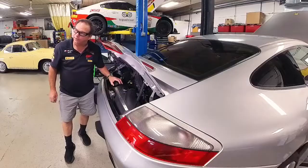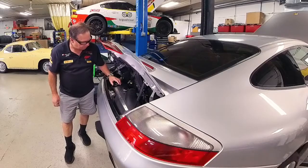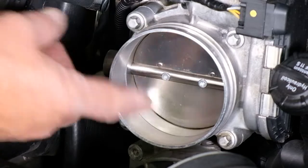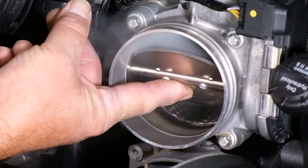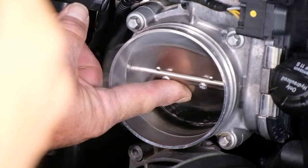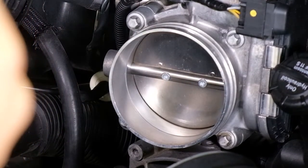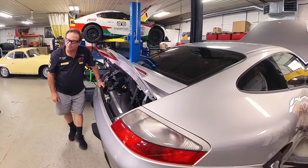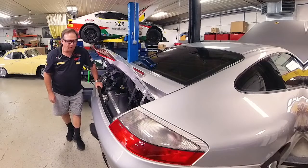While you're in here smoke testing the system and checking the oil fill tube, pay close attention to your throttle body. You notice the little dirt ring that's in the throttle body? We just smoke tested the intake and you can see that ring. The modern cars — meaning the 991 911 that started in 2012 — actually test for this, and that parameter ID will give you a warning on the check engine light. The older cars won't tell you, and they'll have strange running issues, drivability, idle, and hunting issues. All you need to do is clean the electronic throttle body.